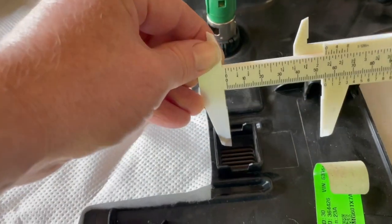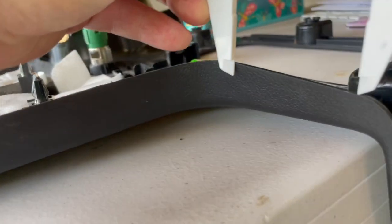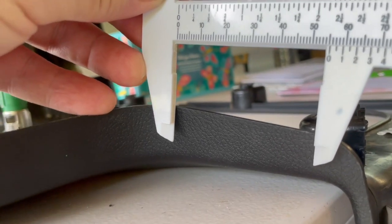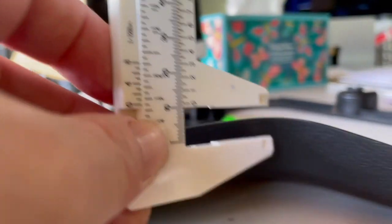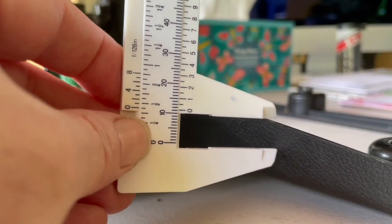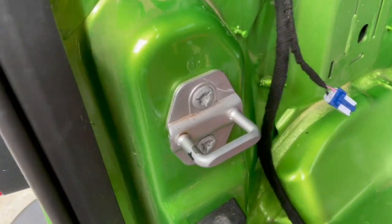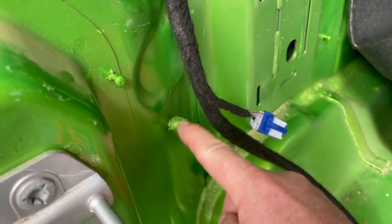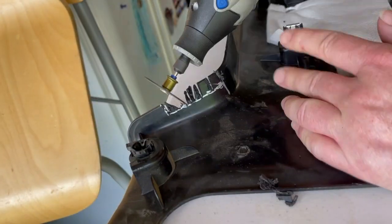but I think realistically I'm going to have to cut that rib there. Cut at least some of these ribs here. And then when I get down to here, assuming this is flush against the sidewall, I'm gonna need to cut about that much out of here. And I'm gonna have to cut about that much deep to get the wires to clear out of the footing. This one, it goes to 11. So the wires will come out of there, they'll go straight down here, and then they'll pass through the little cutout I'm gonna make here, which, if I've done my calculations correctly, the wires will pass right through here.